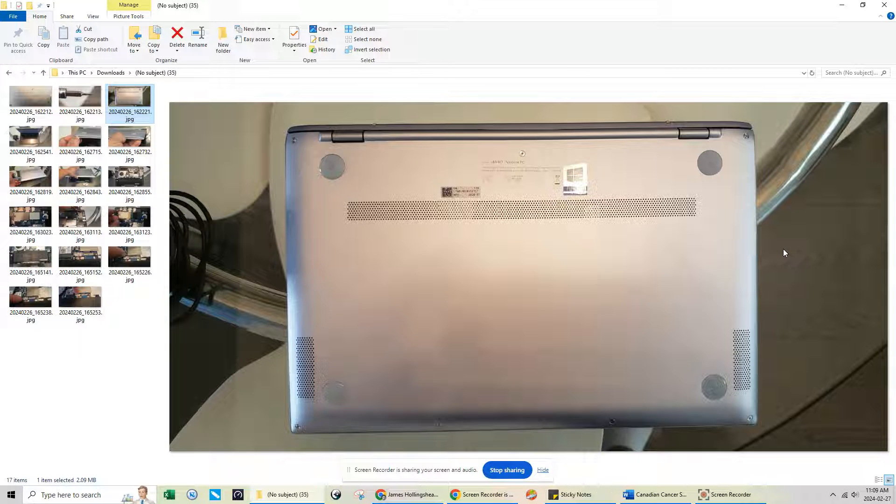First thing you want to do is fold up the whole laptop, close it down, and put the screen side facing down on the table. You'll see there are three screws on the top end - top left, middle, and top right - and four at the bottom from left to right. You don't have to worry about hidden screws underneath the foot pads. There are only three on top and four on the bottom, and all screws are the same size and length, so you can pile them in one section.